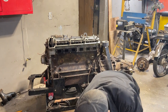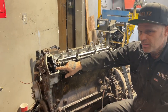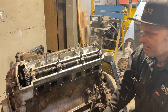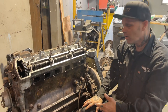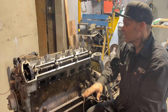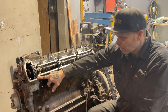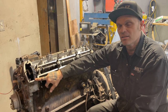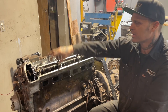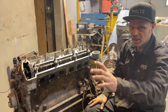When I put the transmission fluid in, there's nothing hitting anything because the timing has not been changed, if you know what I'm saying. Everybody's saying the valve's bent. No, it's a non-interference engine. Nothing is going to hit anything as long as the timing's in place. So that theory, that the valve has hit the piston, is out, because the timing chain is still in place. All the time, it's still timed.